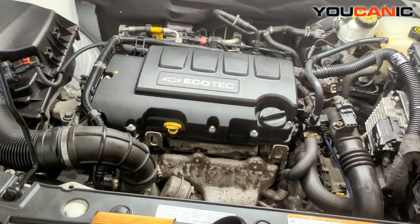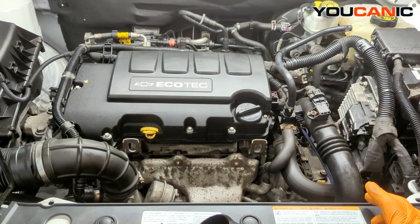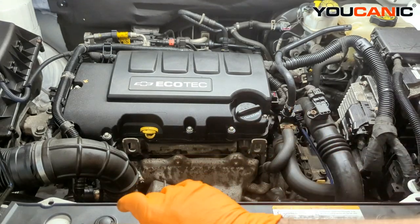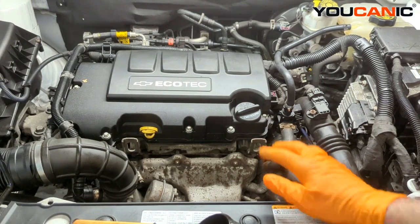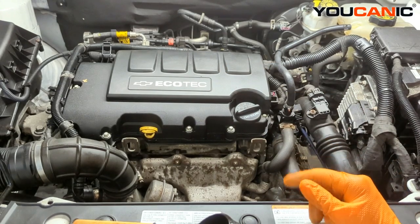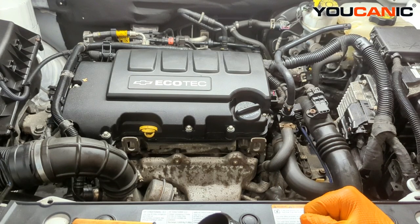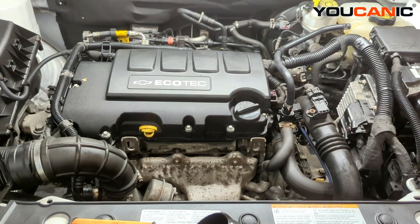So those are some things to look at if your oil pressure warning light is on: check the sensor itself — maybe your sensor is bad — and check whether you have oil in your oil filter or filter housing. Those are the simple checks, and you heard the way this engine sounds and runs, which is amazing — it actually still runs with no oil pressure. I did check the compression on this and all cylinders are actually very good, so we're going to tear this down, replace the oil pump, and see if we can get this thing to run better for the remainder of its lifetime. Thanks for watching Youcanic, where you can be the mechanic.